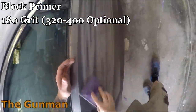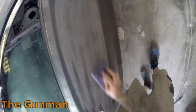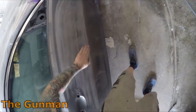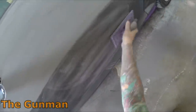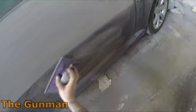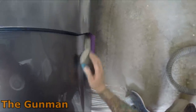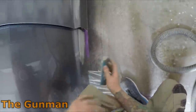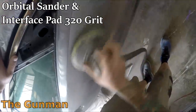We'll start off doing our prep work, get it into the booth, do a little bit of masking, and then start spraying. You might have noticed me wiping all the panels down to give them a really good clean. We've made sure the entire car is covered and masked down to avoid dust and overspray — because sometimes I'll be blocking a repair down and might need to refill and reprime it, so having that plastic over the entire car keeps it clean.